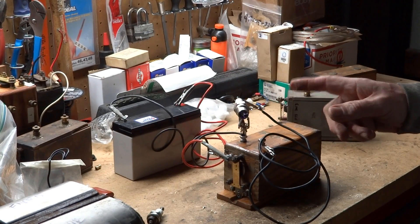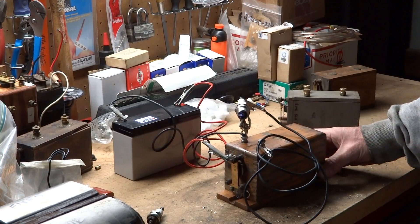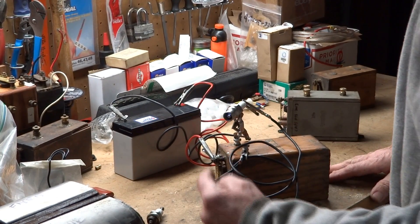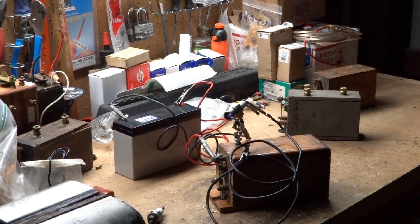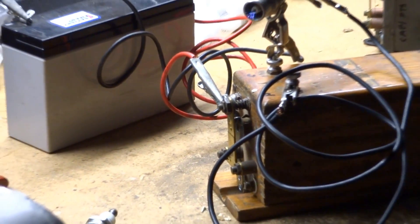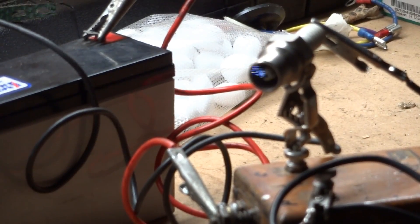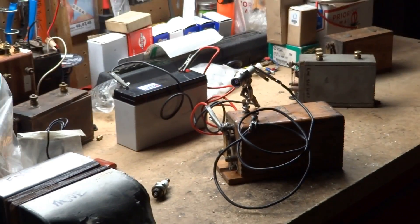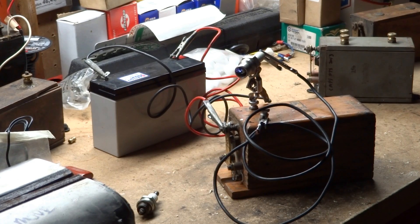You can see how well it produces the spark — it's multiple sparks. The Model T guys don't particularly like that, but the motor car guys do because we know we're getting a good spark. You can also see, if you look carefully, the point vibrating on the top of the coil. Every now and then you'll see a burst of a spark because the voltage generated on top of that coil — even though it's 6-volt input — has residual magnetism and residual electricity, and you'll get voltages reaching up to 300 volts on top of those points as they make and break.